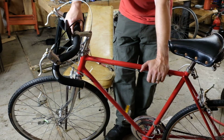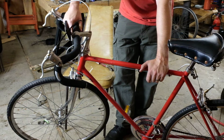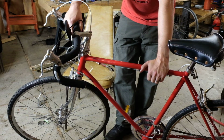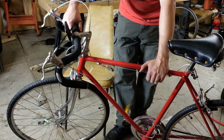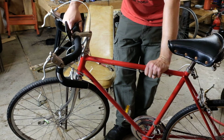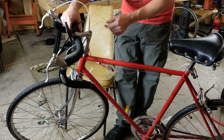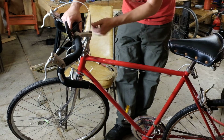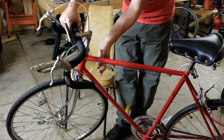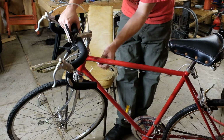Obviously, that's for this type of bike. If you have a bike that's got a bunch of junk in the trunk, your weight distribution will change, and so the braking strategy might change a little bit too. But for just a regular push bike, that is how it is, my friend. So what we have left to do is the rear brake. I'm not going to play with this today because I don't have a cable for it, at least not one that I can trust. But I will show you this. You've got two cables. You've got this cable up here, which goes down and slots into a special grommet in the frame with a special cable end, which is not attached, so you can reuse it.